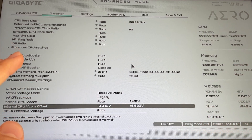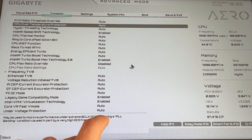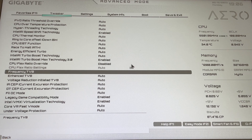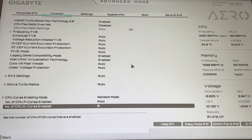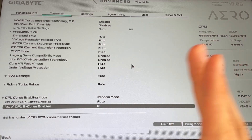If you are only gaming, you can also disable the efficiency cores. Go into advanced CPU settings and look for something like active efficiency cores. You can just disable it — set the number of CPU e-cores enabled to zero and all your e-cores will be disabled. This is recommended for gaming because your CPU will then be an 8-core 16-thread CPU. I do recommend it for gaming, especially competitive gaming.